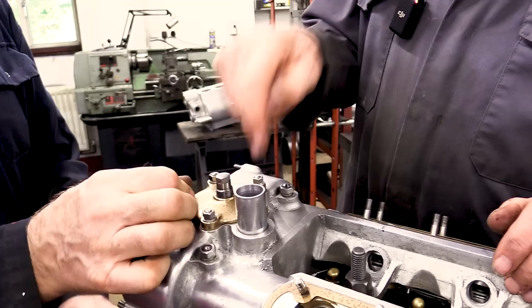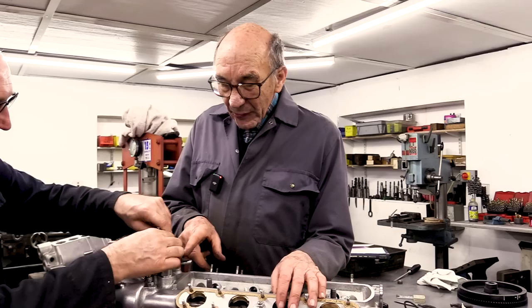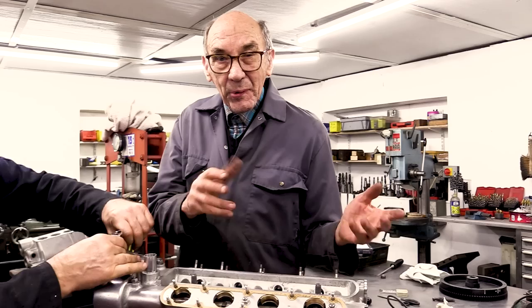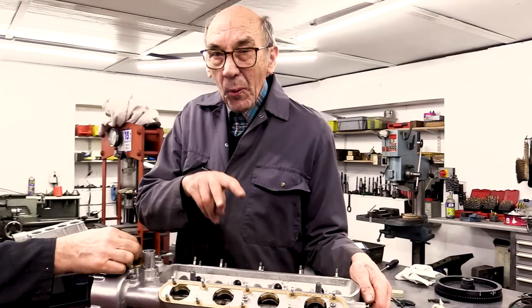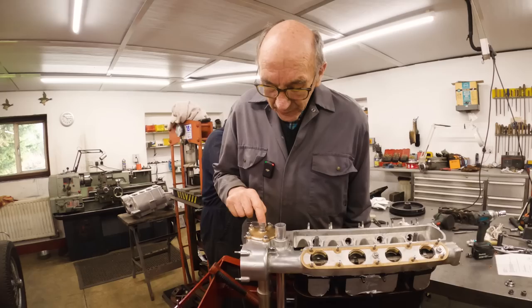That's where you pour the oil in. When you fill the engine up with oil, you put it in there. So very often, if you leave an engine lying for months, it's always good to pour a little bit of oil in there because it goes straight down onto the timing gears and stops them running in no oil until the pressure gets up. Although if moving the hole up works, then they should be in a bath of oil anyway. God, it looks very tiddly-poo. It'd be easy to knock all them dents out, but that means it's had a bit of a life and you can see it.